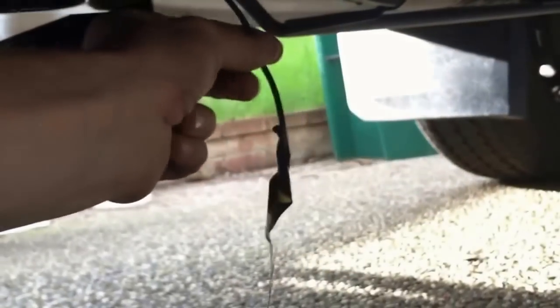Those trailers don't have a brake controller, so this is for the hot wire to supply for this. We don't have our batteries yet — we're special ordering some Outback batteries, which will go up right there. We're going to build a pack for an NE106; it fits right in there. Also on the other side, in front of the wheel behind the propane tank, there's another spot that will fit another battery and we'll tie them together. We're going to run them up, put another hole right up there just like on the other side, and run it up through the roof. We already have the solar panels and we're putting them in tomorrow. So we're going to tie this wire, which is a hot wire for the 7-pin plug, and that's going to supply the hot wire instead of from our battery, because we're going to run some things inside our trailer and we don't want to run down our battery.